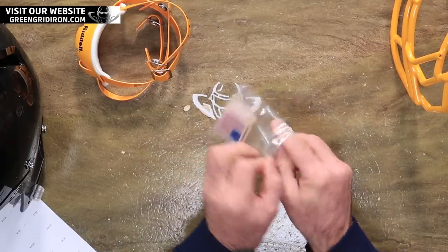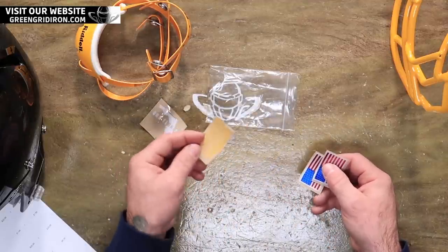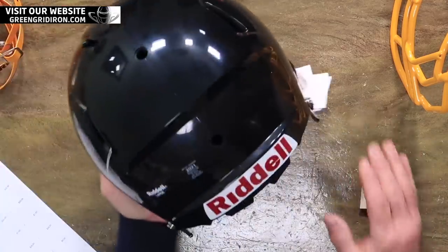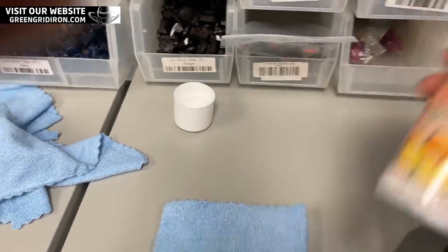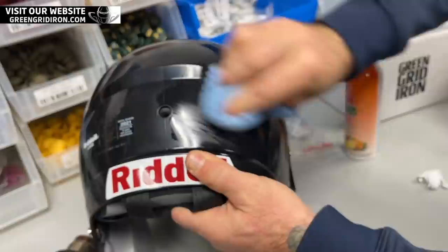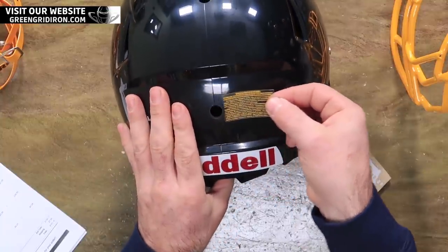Every order of $5 or more you get a free chrome flag decal. He actually bought one, plus a Florida decal, and he bought a gold warning label. I took the liberty of removing the original one — it's not that hard. You use a heat gun, get it nice and hot, you'll see it crinkle, remove it, then use a citrus spray solution and rub it until it comes off. I'll throw the new warning label using this center line right here and go right across.